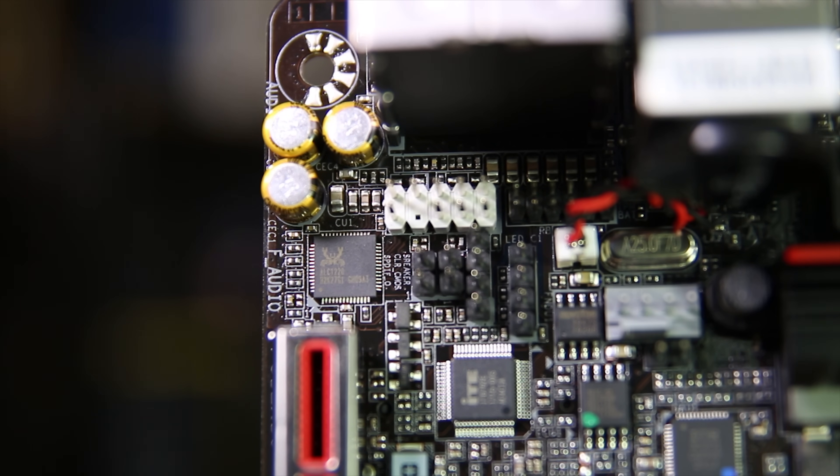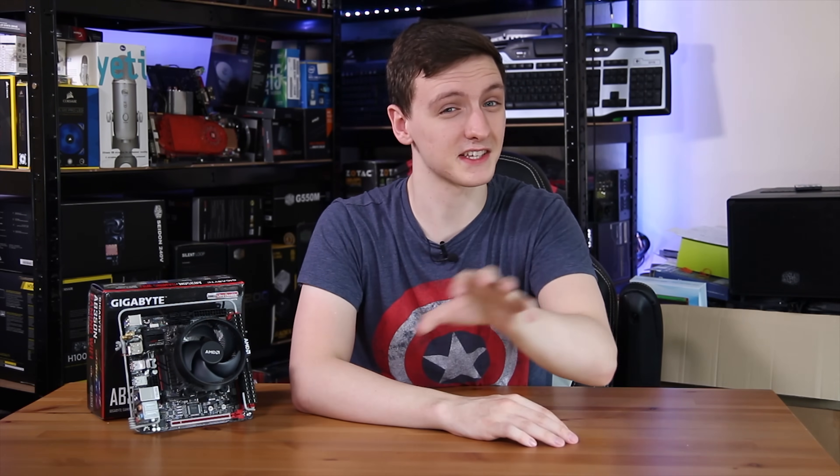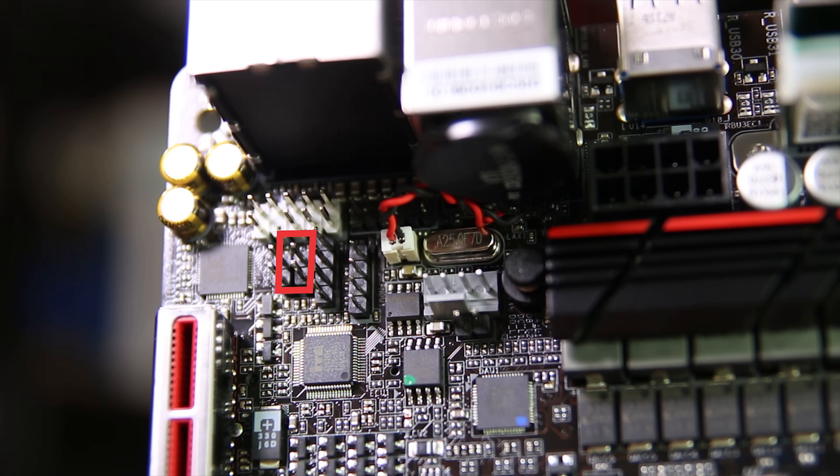You'll also find Gigabit Ethernet and a rather nice 7.1 audio setup, which is pretty awesome. The audio system is powered by a Realtek ALC 1220 codec. This chip is what you'll find on most motherboards, but of course they don't have space for the big packaging normally labeled SupremeFX or similar, so it's quite cool to see that. Right next to the codec chip is the clear CMOS jumper — if you're overclocking or need to reset BIOS settings, it's the second jumper in, right next to the front panel audio header.